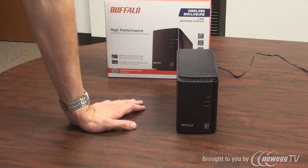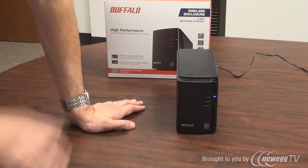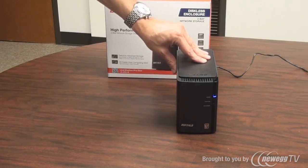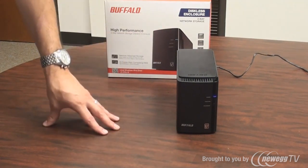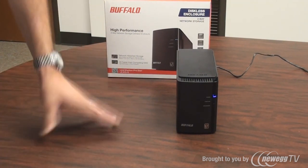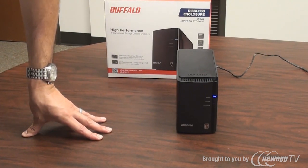This particular product will continue to blink the power button, then the function light will go solid red, and then the power button will go solid blue. When those conditions happen, we're ready to actually transfer the system onto the hard drive we just installed into the LinkStation device. The system is already on the device when it ships from the factory, so we're able to install it without using any software or firmware push utilities. It takes about a minute and a half to two minutes for the device to fully boot up where both lights are solid.